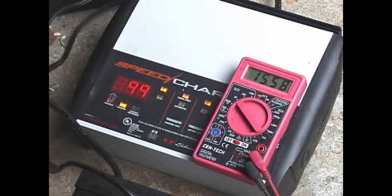The speed charger will keep charging until it gets to 100%, then it'll level off and stay there for a while and go back down. I don't particularly recommend the speed charger — I would go with the old-school transformer style because they're more dependable and don't break down. The speed charger is nice in that you can hook it up and walk away, but because it won't stay charging and you can't manually set it, a lot of batteries like to be charged at low rates for long periods of time, days and days. It doesn't really have the ability to do a 2-amp trickle charge for days to bring your battery back to health.